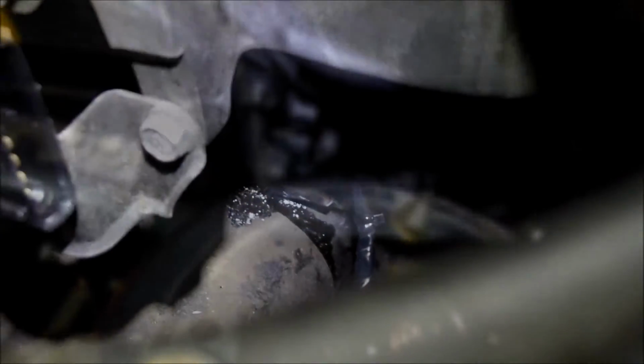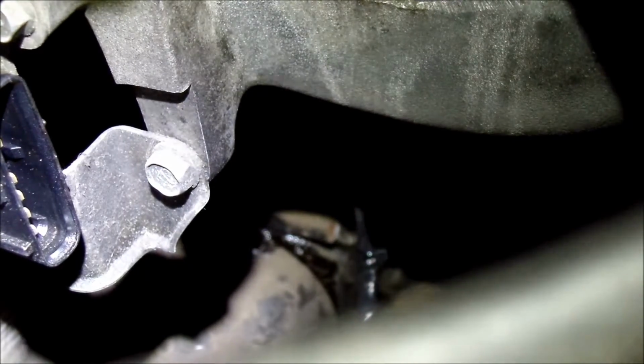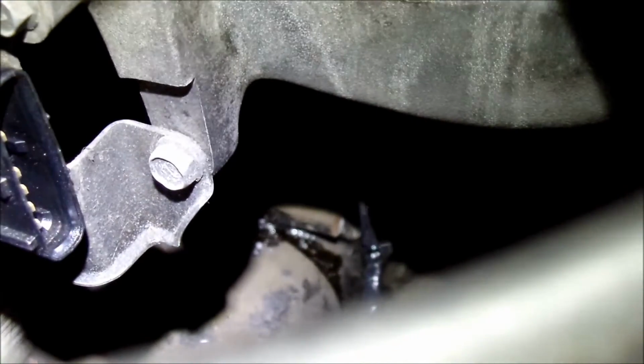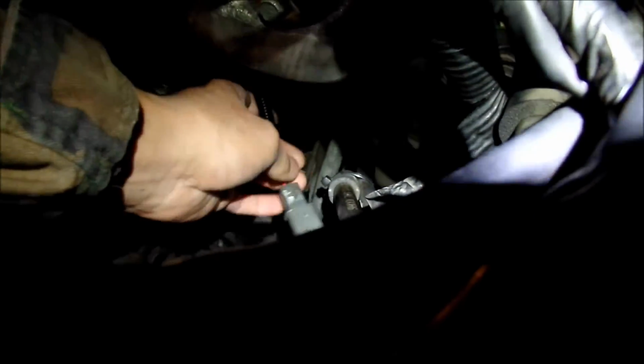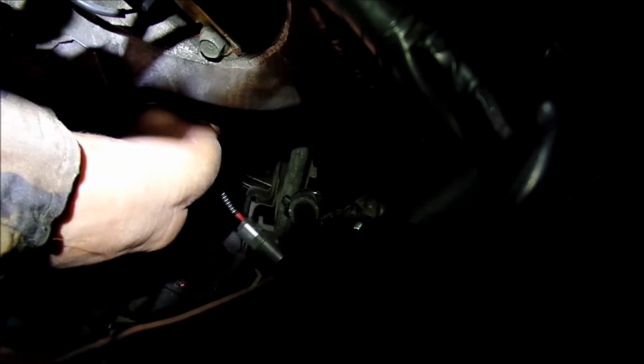I don't know how well you can see it, but it's been wrapped, and I zip tied the electrical tape so it doesn't come off due to heat. Then I'm going to put this loom around it. I got so much. It's not that much, but hopefully that should protect everything. Knock sensor wire repaired. Look at that. Not bad. Good job. Just got the loom over it. Looks like a professional job. Should protect it for many, many years.